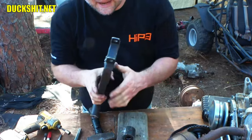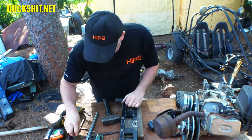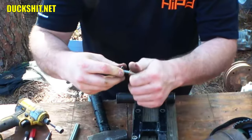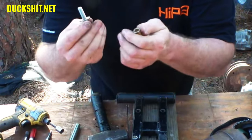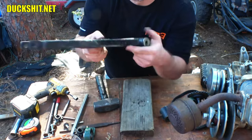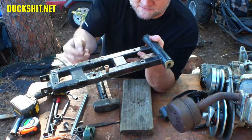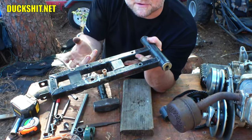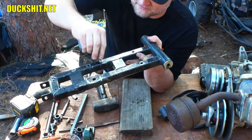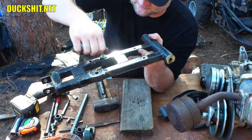That's good. We'll come in here with a grinder. We're gonna clean this up, and then we're gonna use some riv nuts. These here are riv nuts, and these are fantastic. I've talked about these just earlier this week in one of my Volkswagen videos. And what we're going to do is we'll drill a hole in here, we'll attach this in there, and then we use a tool that pulls it together just like a pop rivet. What it does is it creates a threaded nut, which allows me to thread in a bolt. And these are actually riv nuts and they're already in place.